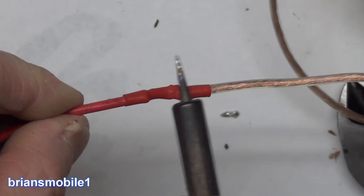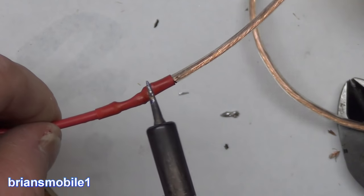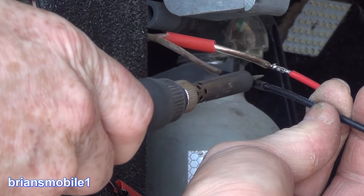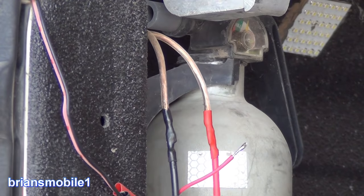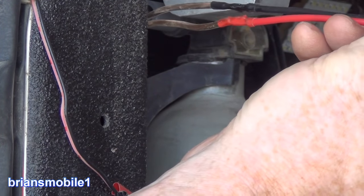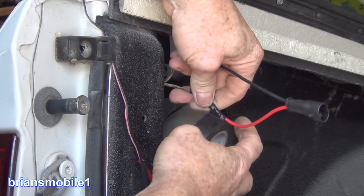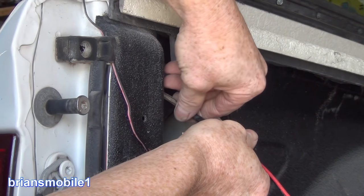It'll heat shrink just as good. It won't come out quite as pretty or as tight, and if you're not careful and hit a bump with a hot iron — especially with the tip — that can cause a break and it won't insulate as well. But by and large it's not a bad way to go — keep it moving. You're going to get a waxy P-TEX kind of smell. If you really want extra credit, put some silicone dielectric grease on it first — that'll help keep moisture out and make it more abrasion resistant. By the time you put electrical tape over the positive first and then wrap your negative into it, you've got years of service out of that. Get a little stretch in that vinyl tape and it'll make it a tighter joint. Go right back over the top and give it a little tug so your fingers aren't in contact with it — that way it'll stick good.